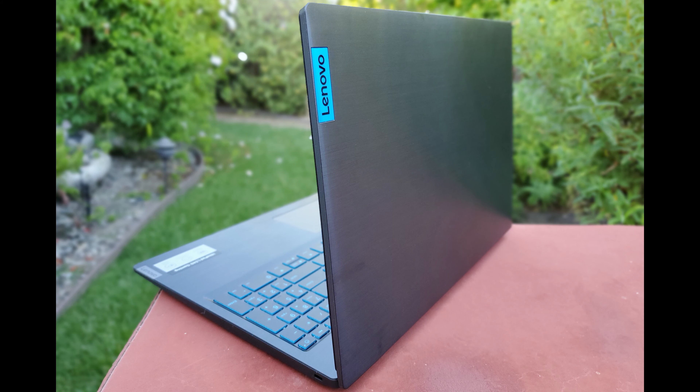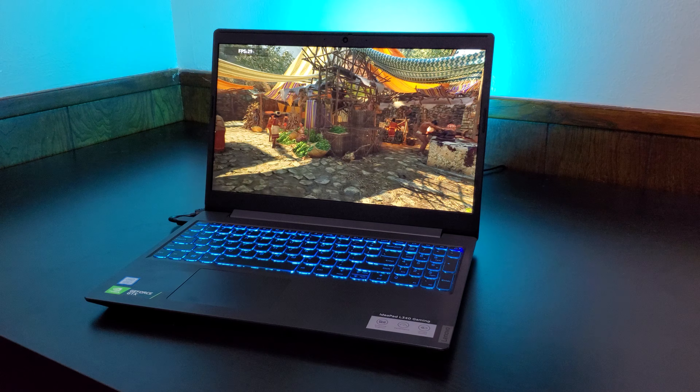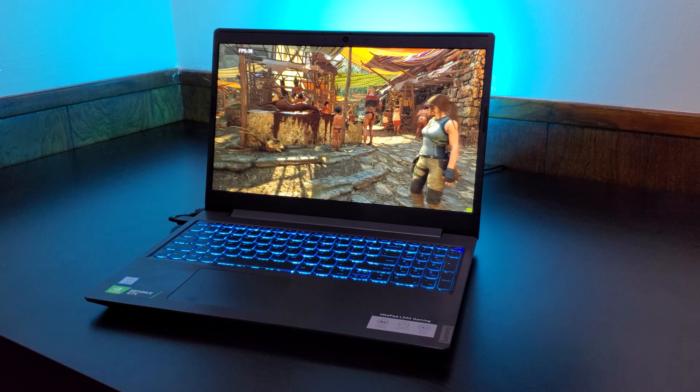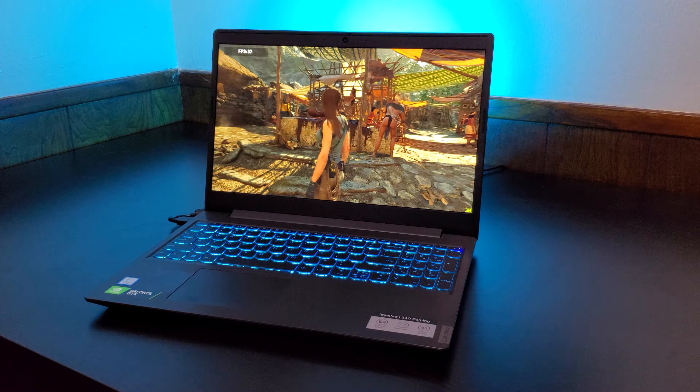Because of that, it doesn't have as much ventilation that we usually get on gaming laptops, with vents on the bottom, the rear, as well as the sides. This one primarily has ventilation from underneath the chassis and then underneath the screen as well. So to get the performance that I wanted out of my unit, I had to undervolt mine, which is a very simple process using either Intel XTU or Throttle Stop. I made a how-to video on that — I'll put a link in the description below. With that quick fix of undervolting, this laptop has really proved to be a great performer over the past few months.